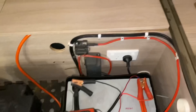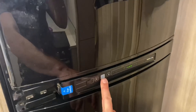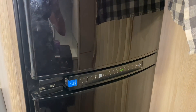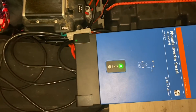The process is: the battery charger is that black plug there — turn that off, otherwise it's going to try and charge your battery off the inverter, which is counter-intuitive. Next, the fridge — make sure it's on gas. The hot water service has to be off, otherwise that will choke it as well. I'm going to turn the inverter on — that's on.